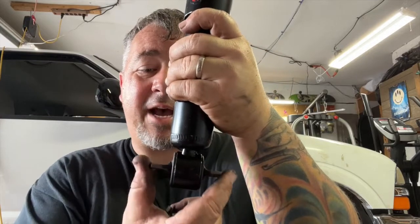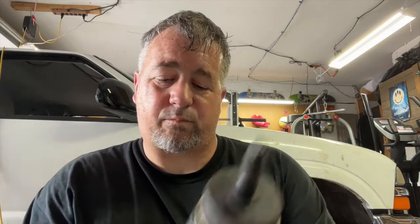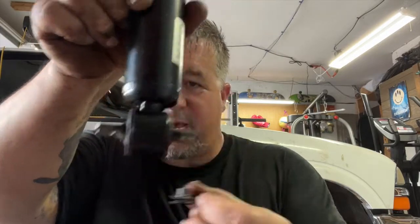But the way this mounts underneath is you see these bolts. At the bottom of the tower, there's these little things called speed nuts or U-nuts, depending upon where you live. And what a speed nut looks like, it's this. And it clips onto the metal of the tower. And then this goes up through and you run a stainless steel bolt and washer up through this. So basically just replacing all of this stuff. We're doing this, 24 years of dirt and grime and rust and corrosion, it's pretty much just got to swap all this stuff out.